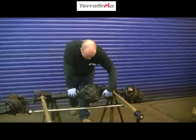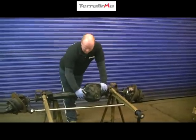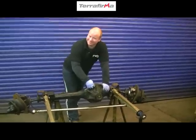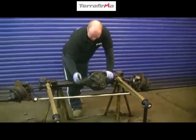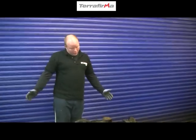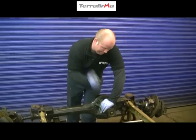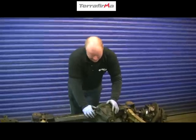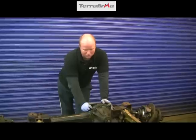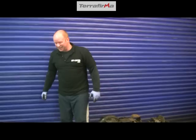I think there's ten or eleven bolts around the diff — this is the differential. So after you've done your prop shaft, undo all your nuts around there, which I have done already — here's one I prepared earlier. Last nut. That's another thing: usually it's glued in, so you've got a choice. You can put a block of wood there, beat it sideways, and then maybe get some form of lever in there. A chisel is what we normally use, a nice sharp one, so you can just tap it in there and break the seal.